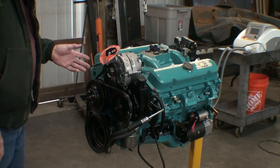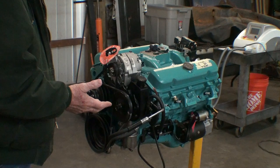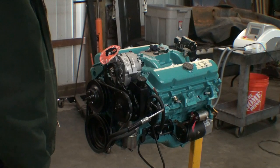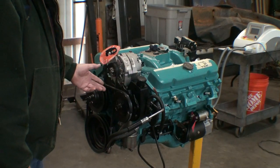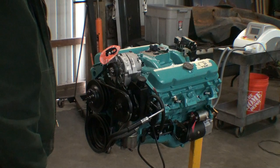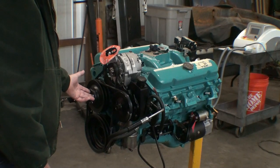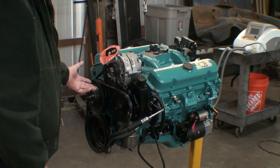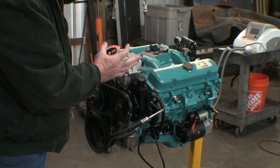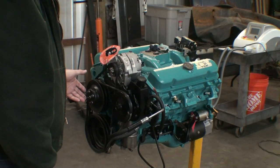The reason I'm saying all of this is when I was a kid, my friend's dad had a car, and he said if you can get it running you could have it. We looked at the timing mark and it was on the compression stroke — everything looked right — but it wouldn't start. So we took the timing cover off and looked at the timing chain. Somebody had put the marks off — they weren't lined up. There's a gear with marks that should line up with each other, and it was off. So even though the timing mark read right, it was wrong.